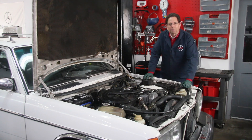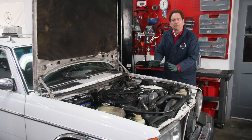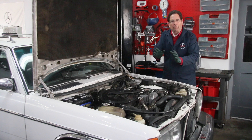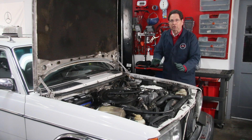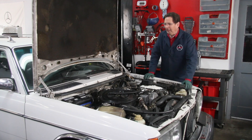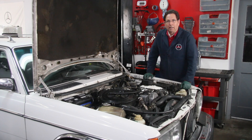I'm not 100% sure that injection pump timing is going to be the issue here, but I can't keep working on this until I determine that the injection pump timing is correct. Along with that, I want to make sure the cam timing — the timing marks internally in the engine — are correct too, because if there's something off with that timing, I could be working forever trying to find this problem and waste a lot of time.